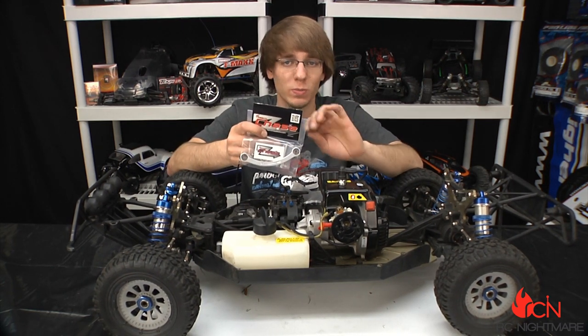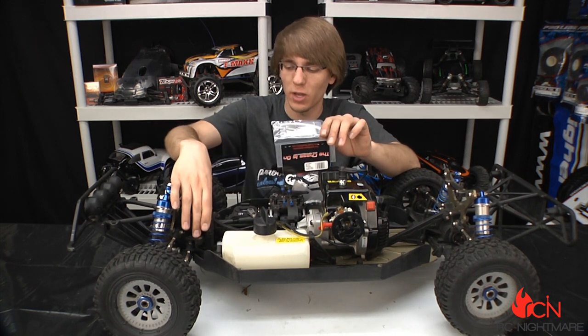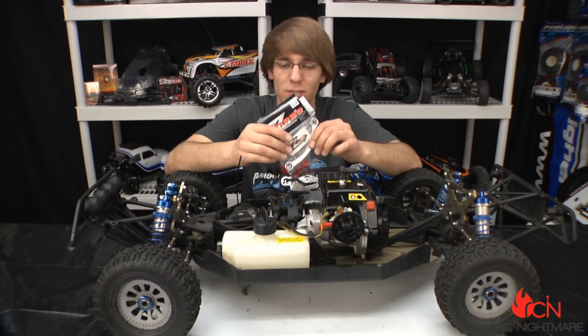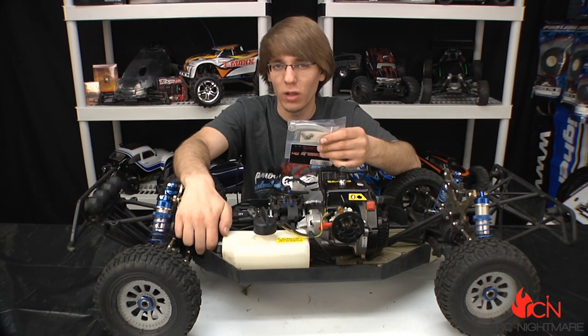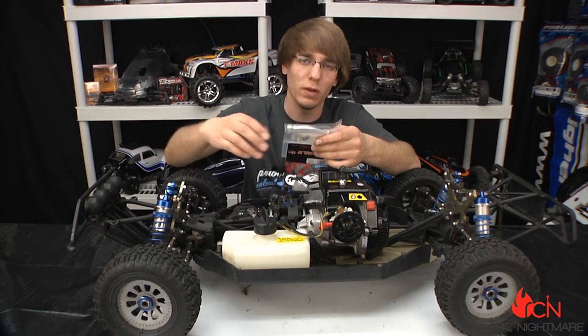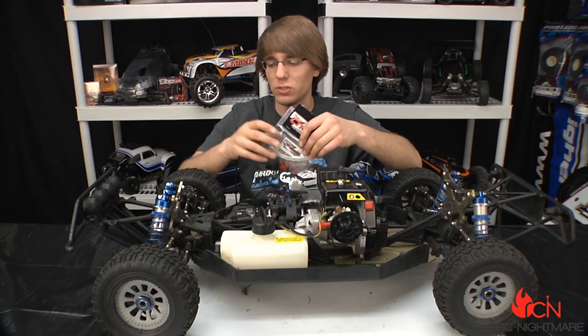Team Chase has made a really nice upgrade — we have captured ball bearings so there's no bushings, which means no slop. Full-on ball bearings with nylon spacers to make up for that extra height, so we won't have any lateral slop either. This is a billet piece, nicely engraved, and they have extended hardware. The stock hardware doesn't go through enough threads, so you can have problems with it ripping out or stripping. Here we have a long bolt and nut setup, which is gonna tighten up our steering and make it more precise.